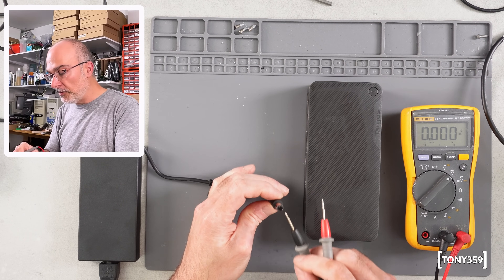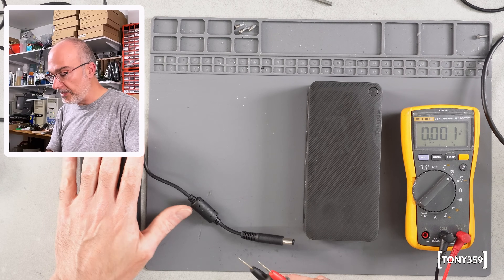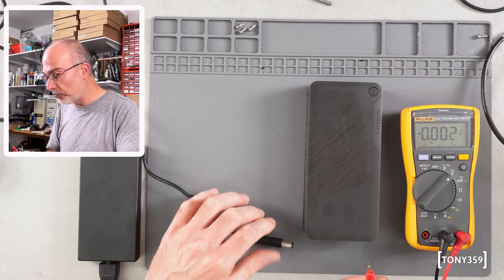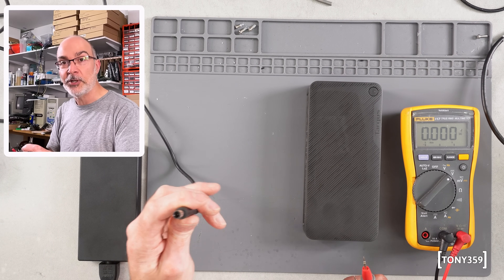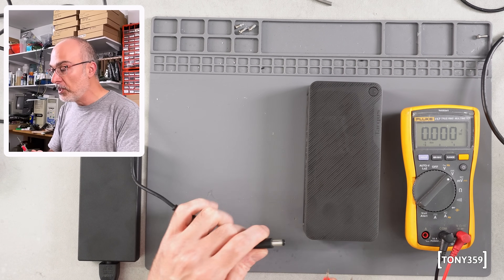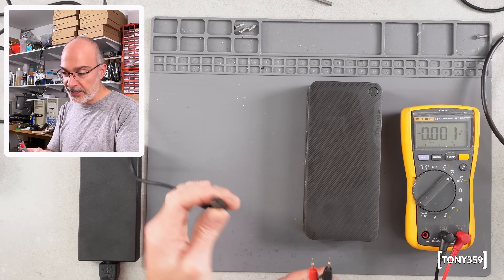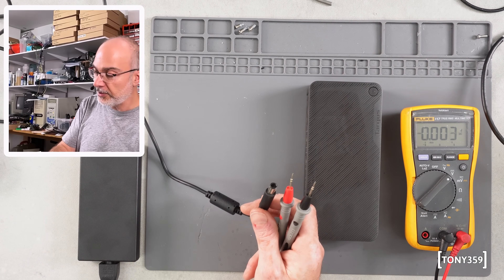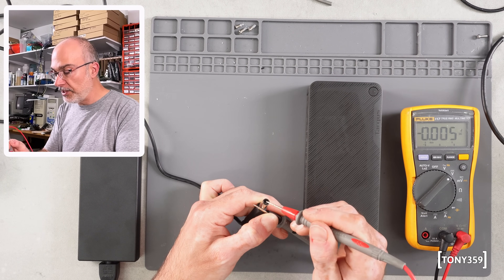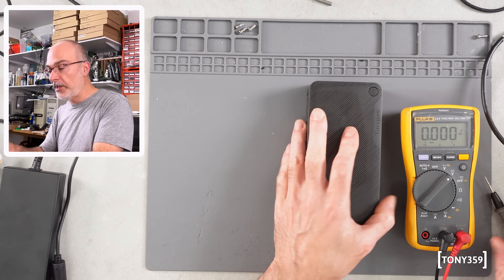It's kind of difficult to test the power supply because I haven't got anything that fits into this very big plug. But I can tell you this — I have more or less an identical power supply, because this is a replacement: my previous Targus failed and was replaced with this one. I tried the working power supply into this and it does exactly the same, so I know there is a short in the Targus. To get the power supply back up I just need to power cycle it, and when I power it back up I think it should be 20 volts again. So let's assume we have a short within the Targus.